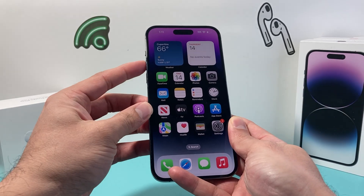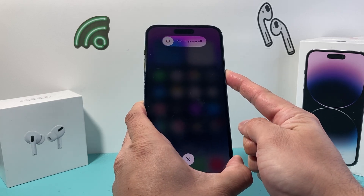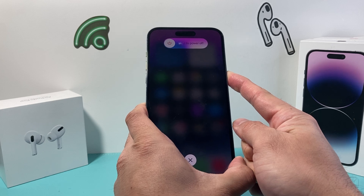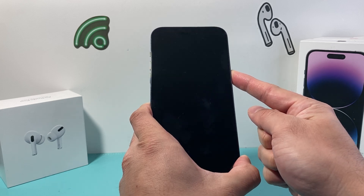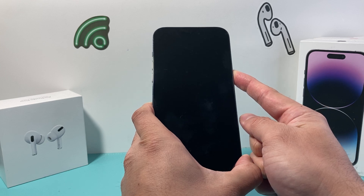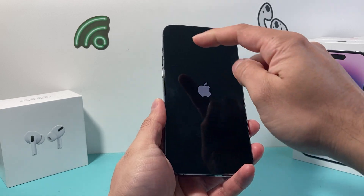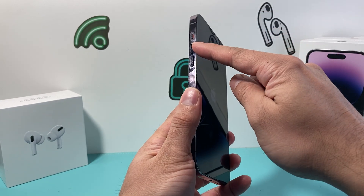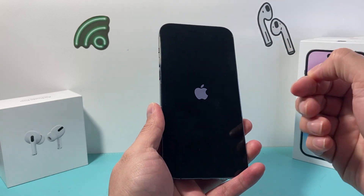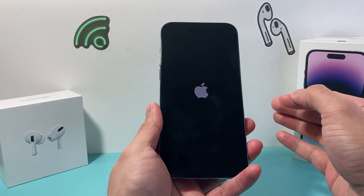In real time it's volume up, volume down, and then you hold that side button just like that. While doing this you don't have to slide to power off, because that will be a normal shutdown — we're trying to force it to shut down. The screen will go black for a few seconds, then once you see the Apple logo appear, let go of the side button. You might have to do it a few times, but make sure you press and release volume up then volume down in that sequence quickly before you hold that side button.